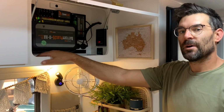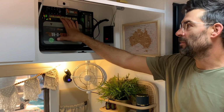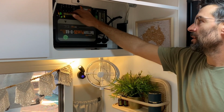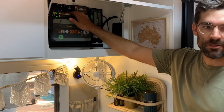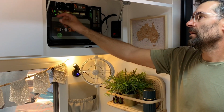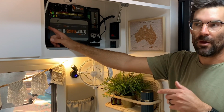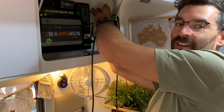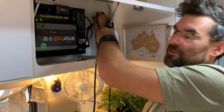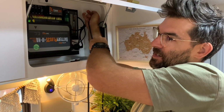So the last piece of the puzzle will be the 12-volt power supply. As you can tell, I've got all my power supply right here in this cupboard as well. So I'll just pick up a supply off any one of these feeds that do other 12-volt services in the caravan. And then that's just a cigarette socket for the power supply to the router. I'm just trying to pull the cables through now from the back of the fridge into this business end of the caravan.